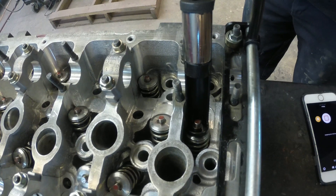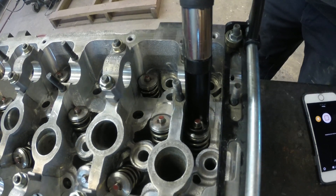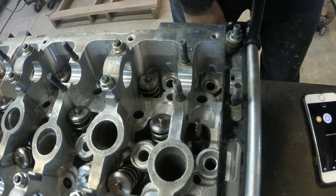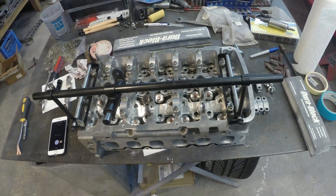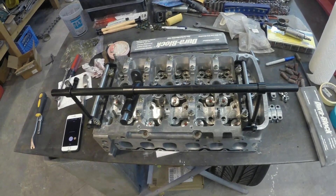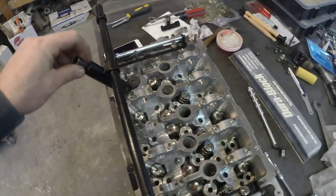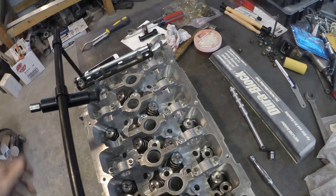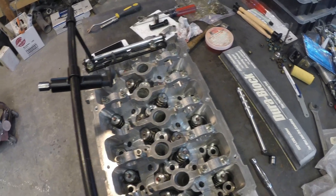A little bit of assembly lube on the valve holds those retainers in place, and it was done 23 other times. This is the valve spring compressor I'm using — I picked it up off Amazon for about 130 bucks. If I'm not feeling lazy I will find the Amazon link and post it in the description. It's really nice because it threads down and holds tension, so both hands are free to use tools or whatever you need to get the valves in place.